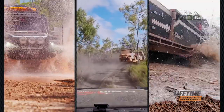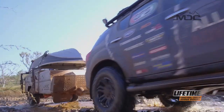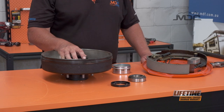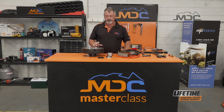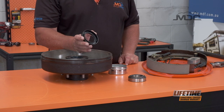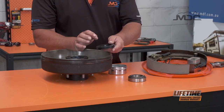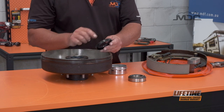If there's not a long queue at that water crossing and you dive straight in, the water's deeper than the hubs, you cross through the water. What actually happens is the entire hub assembly cools very quickly and the only thing protecting the grease and the bearings from water ingress is one, a friction fit grease cap, and two, a rubber seal that is actually designed more to keep grease in and stop it from escaping than it is to stop water from getting sucked by the seal between the axle and into your bearings.